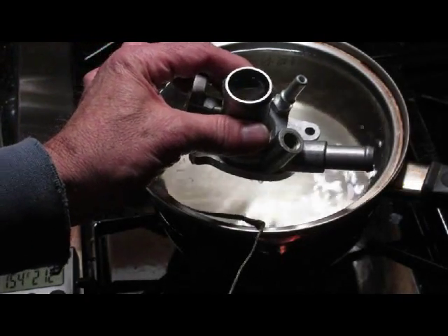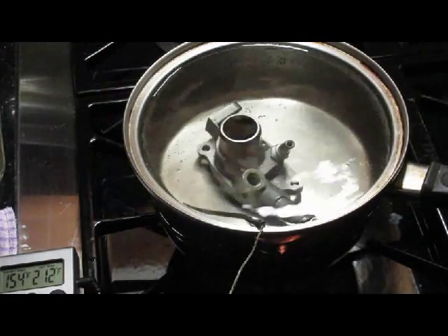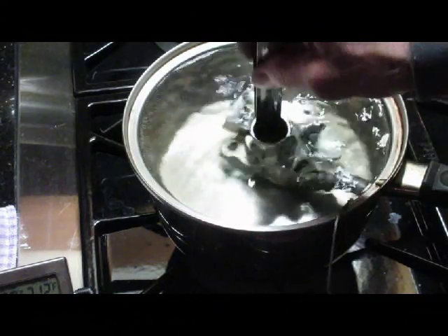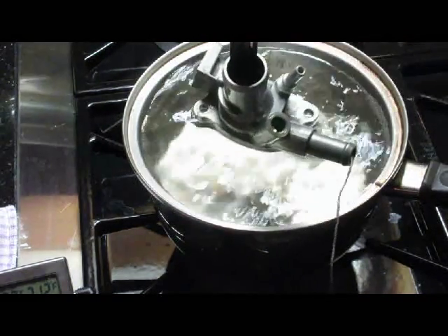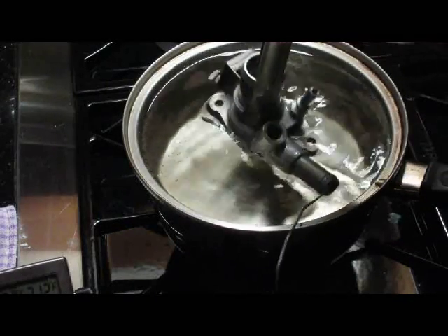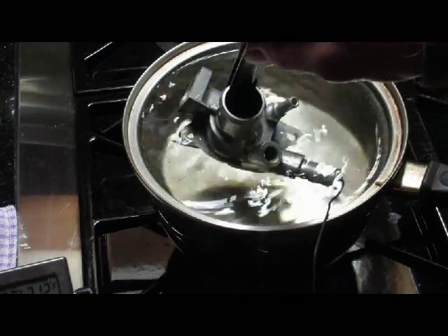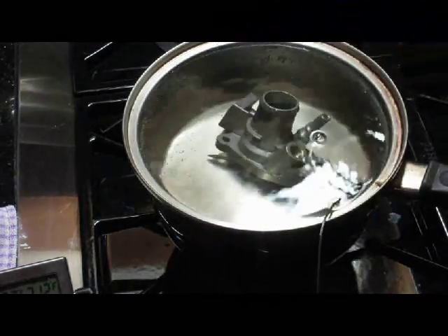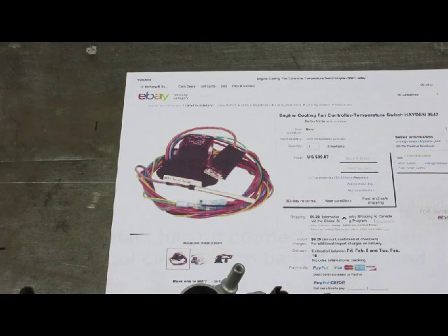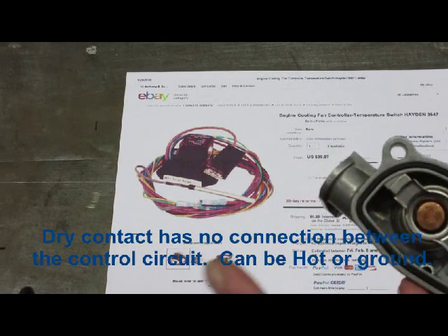You can see at the top of this thermostat I've filled it with water so we know the thermostat's closed. I'm going to dunk it in the water - currently at 154°F - and warm it up to see when it opens. The water is going through it now, we're at 167°F, the thermostat is now open. That's just because we crimped the sides in on it. If you go too far, the only thing you could do is get another thermostat and put a bigger spring on it to counteract the thermal pellet moving. There's a solution with a stock Fiat Abarth thermostat to make it open at a lower temperature.